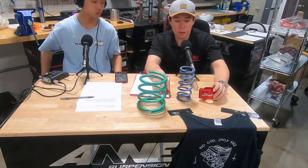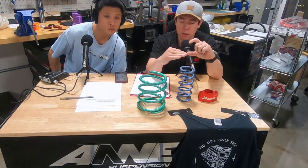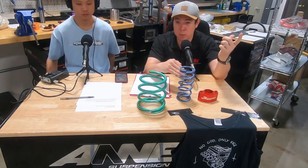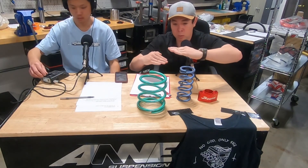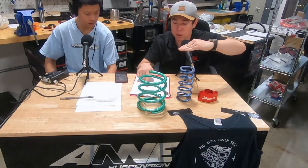Yeah, we talked about that a little earlier. If you have a swap that's lowering the subframe, you're lowering it because you're trying to make space for an engine that's much taller than the original 4AG — which is an extremely compact four-cylinder. So when you put a beams, an F20, or an SR in there, you often need to lower the subframe just to get the engine to fit under the hood. That does all kinds of things to your geometry. Your lower control arm used to be horizontal with the mounting point at the subframe, but if you lower the subframe, it now points toward the ground, making a really low roll center — like we talked about. That's part of the reason why we have these beams RCAs, to help address that.